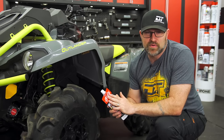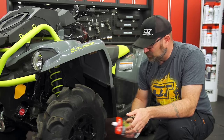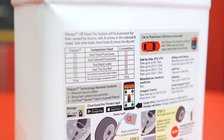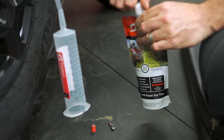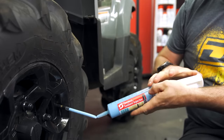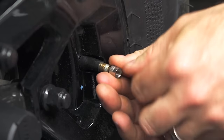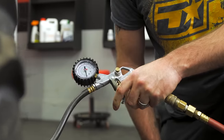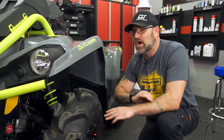This is because there's less material present, and it coats the inside of the tire more evenly. Just follow the instructions and reinstall it as you did the first time. There's a metering chart and sealant-specific injector included when you buy TireJek, so you can quickly install the right amount through the tire's valve. It's super easy, and you don't have to worry about having too much or too little sealant inside the tire. Just inject the sealant, reinstall the Schrader valve, and add air pressure. As the tire rotates, the compound moves around inside the tire, completely coating all surfaces.